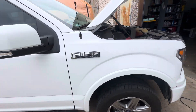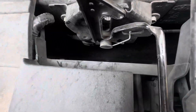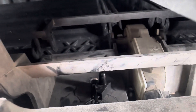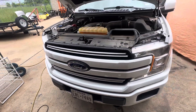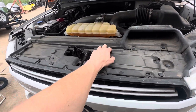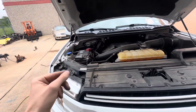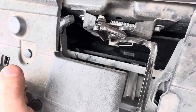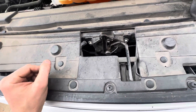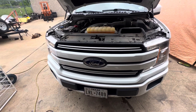I don't know if your truck's like this, but this one was. In here there'll be a dummy connector — two wires and an eight-pin dummy connector — and that is the old temp sensor location. So you can pull this piece off, pull the dummy connector out, and then you can hijack your temp sensor from your old mirror, because it's not going to work in your new mirror. Hijack it and wire it to here. You can either use an aftermarket connector or just wire it directly and put a zip tie through the hole — the provisional hole — and it'll work again.